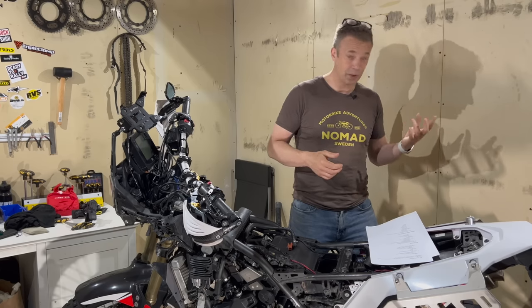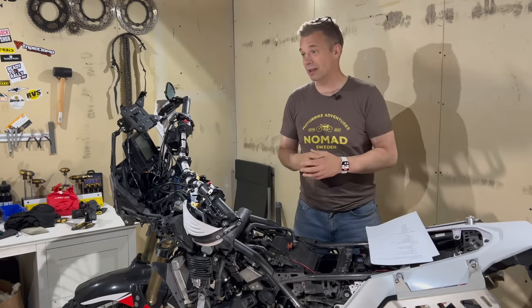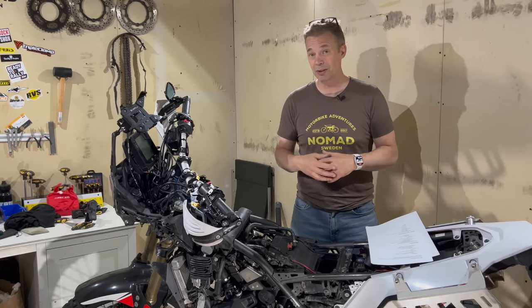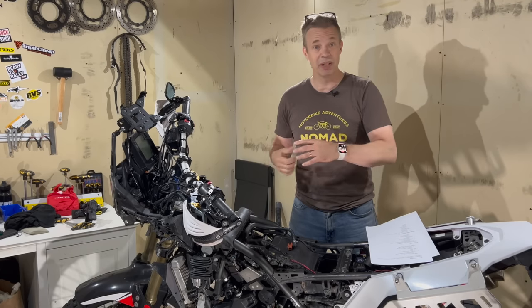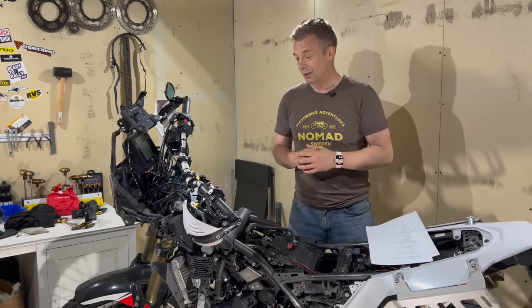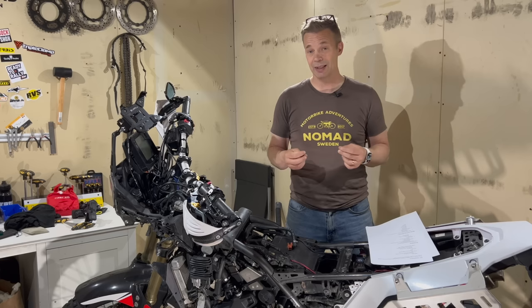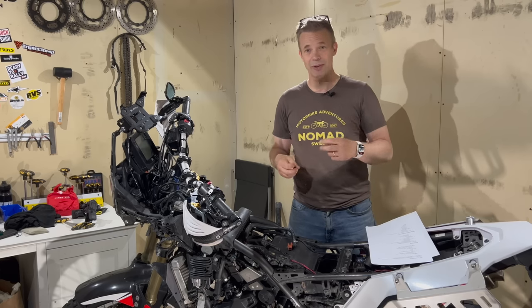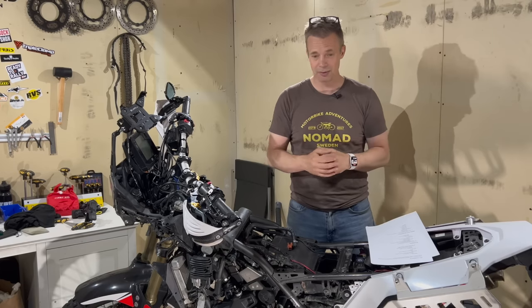And to start off with that, we have the brake pads. I changed my first set of brake pads at around 10,000 kilometers, which is quite far compared to many others. Maybe I don't brake as much, not sure. And I switched to sintered pads instead because they are harder and rougher and tougher, for off-road and all of that, according to what I read.